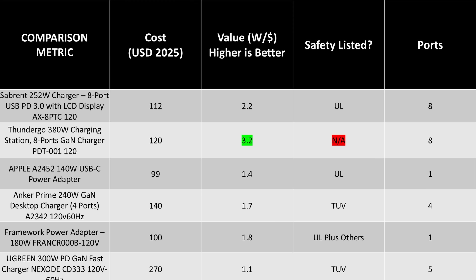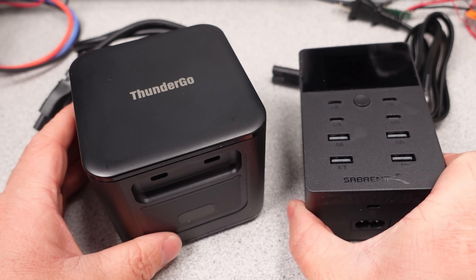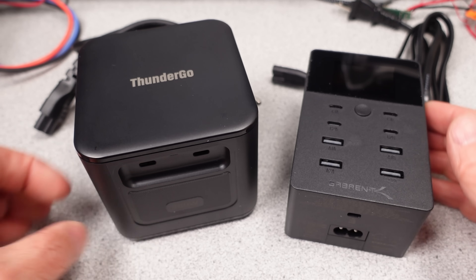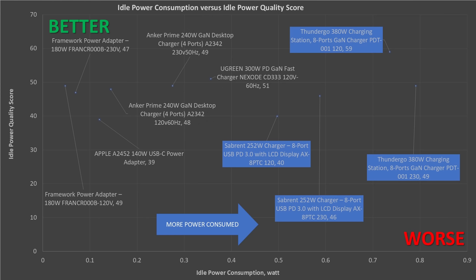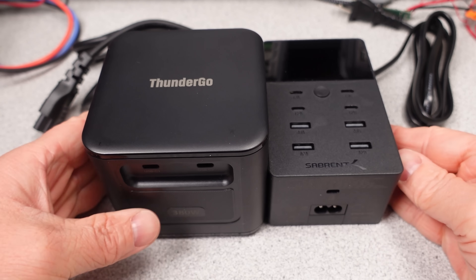The device can save some of that cost by not having a safety listing, but across the sale of many units it's not that much money. The Sabrent is a strong contender in the price market considering it meets all the requirements. When looking at the idle graph for these, regardless of voltage, they're all on the higher side — still all sub-1 watt if you don't have anything plugged in, but a bit much for sitting around doing nothing. The Anker Prime 240W adapter is really an example of how to do low idle power consumption right for a high power multi-port device. The average power consumption graph is more spread out. The Sabrent takes the lower spots on the chart — still not terrible, greater than 90%, and stronger numbers at the full power level. The ThunderGo is running away with it on efficiency, taking some of the top spots, on par with the Apple 140W adapter, which is a very efficient adapter.